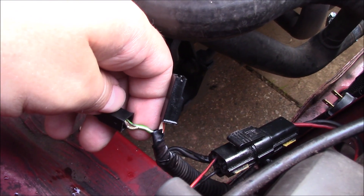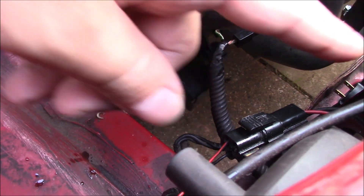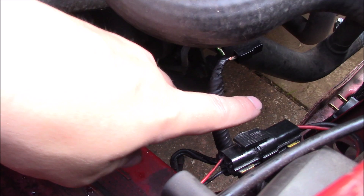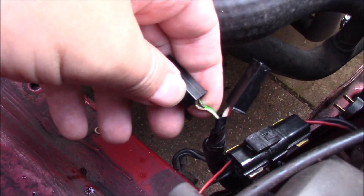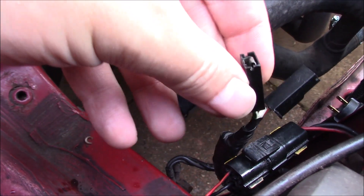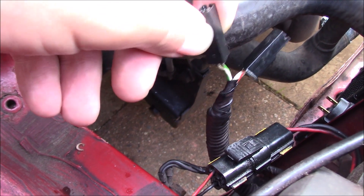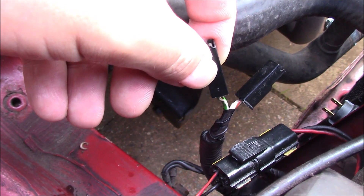I think when I'm losing the connection, it's that split there. The other fan switches I bought are definitely dead — I've tested them separately alongside the one that's currently fitted, and they're definitely, definitely dead. So I know that the first problem was a fan switch issue. Now I know the second problem is that little exposed wire there. Ideally that means rewiring it, and I don't have the materials right now. So I'm going to plug this back in and we shall see what happens.